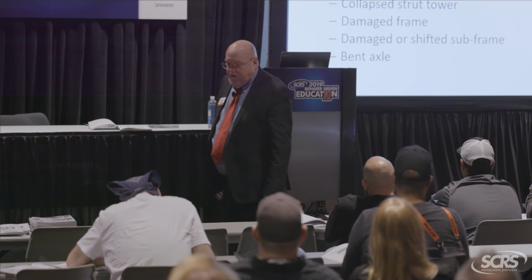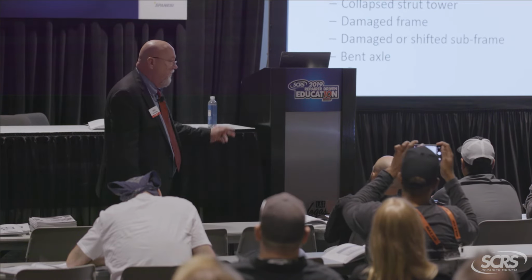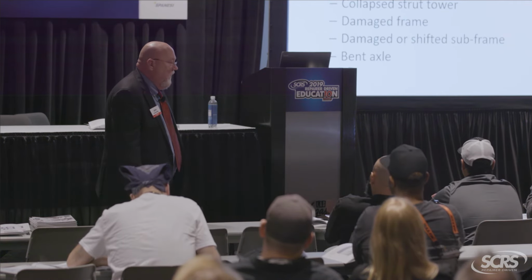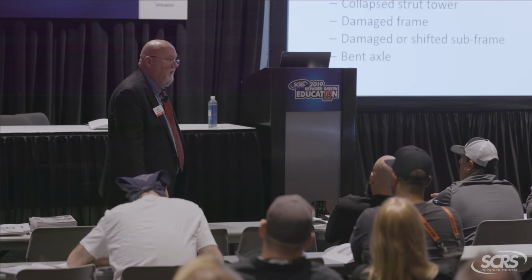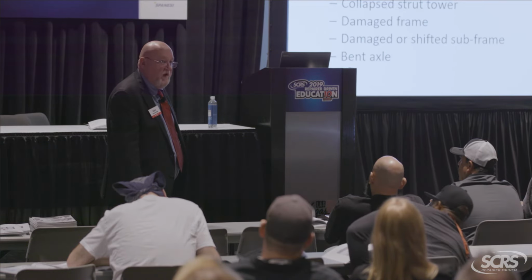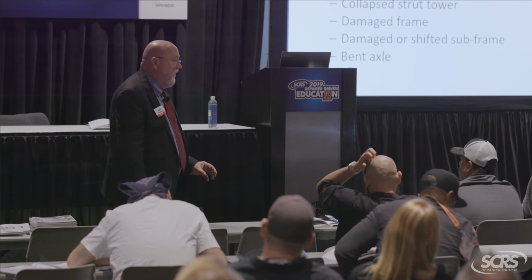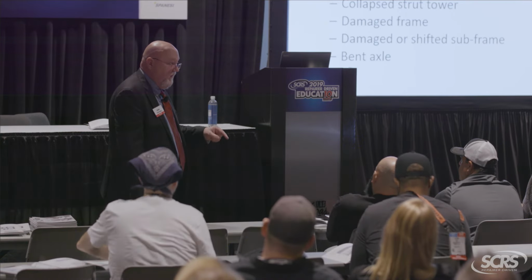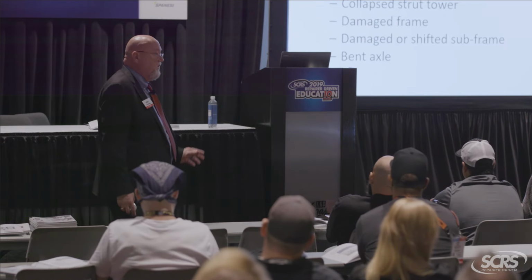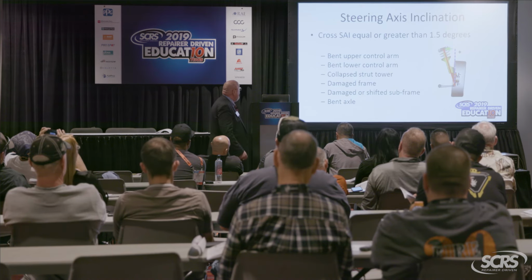So I've argued with ICAR. I used to be an ICAR instructor for many years ago. Got out of that, like I said, when I took this on full time. And I tried to get the curriculum changed, and they said, we can't change this curriculum because it's been this way for 30 years. That is not a good reason not to change. So when you see that 0.5 number, please let everybody know that it's 1.5. And that's documented in that book that I gave you there, okay? So you're looking for large side-to-side differences of 1.5 degrees or more in order to find the damage there, okay?